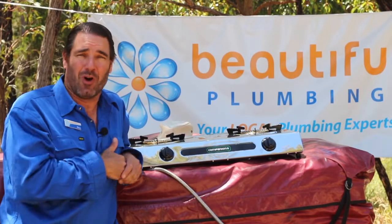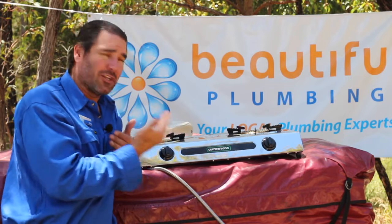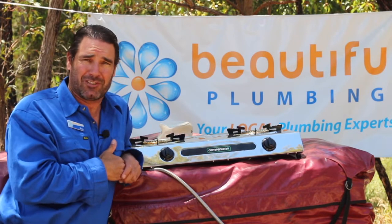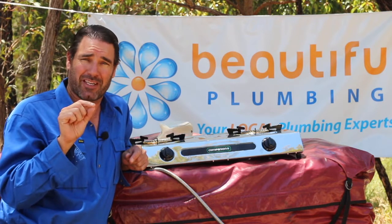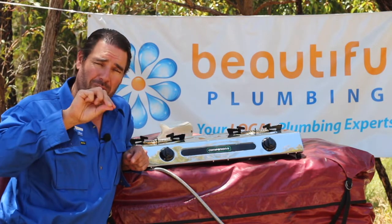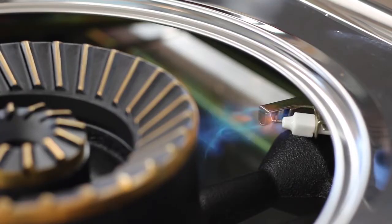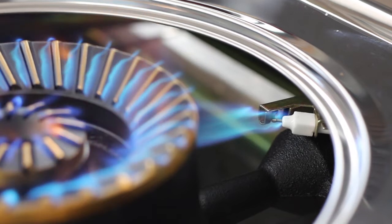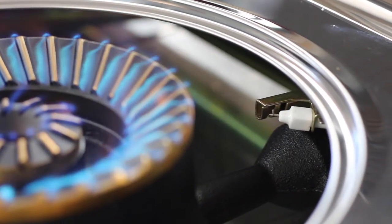This is the owner's double wok burner, made by Companion. It's a little big, but it has some great features. One of them is that the ignition system has a flamethrower on it. When you push the button in, right before it sparks, it shoots gas over a little electrode that lights it, and that means it throws a flame up onto the burner. So even in windy conditions, it'll light very easily.